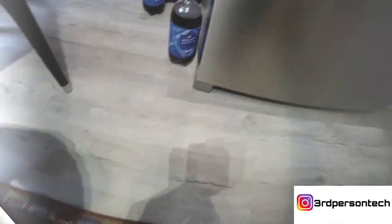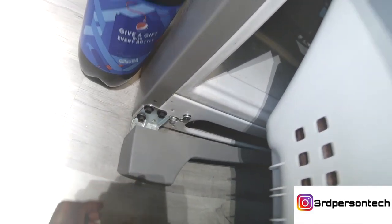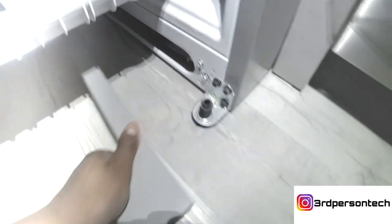So what we're going to do on this Frigidaire model is take off the bottom cover. We're going to pull the freezer drawer out and lift the bottom cover — you lift it up and it comes right off. It's like a hook; go to the other side and then lift it again. Then slide the cover over and push the freezer door back in.